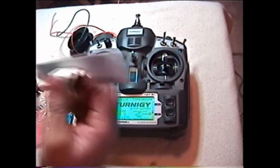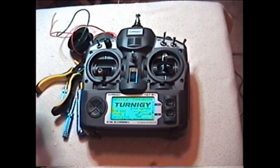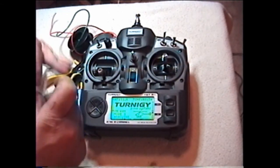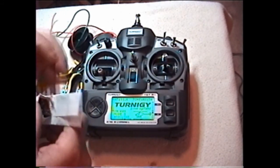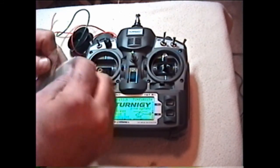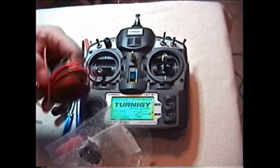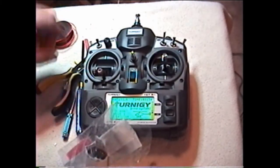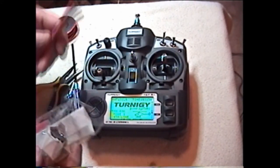It kind of looks like this: a 12-volt EL power inverter. You can find them on eBay. When I did the mod — which isn't too bad — you have to open up the radio and do some soldering with some wires, and you've got to find the correct position on the radio to solder to, and heat shrink everything so you don't have any power problems.